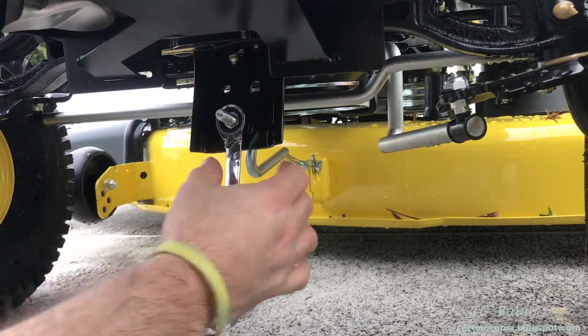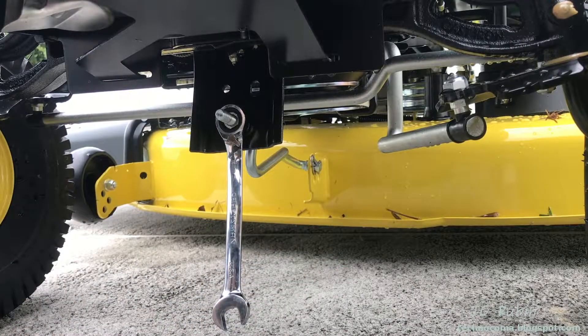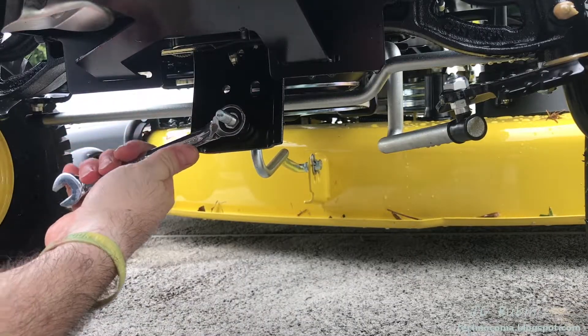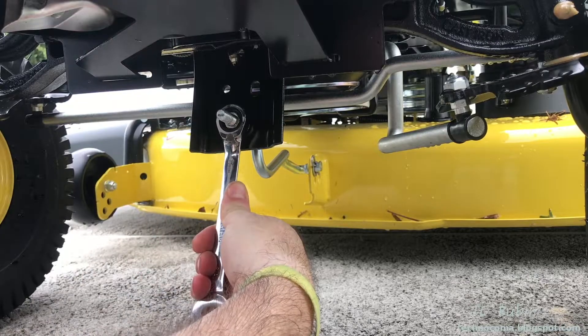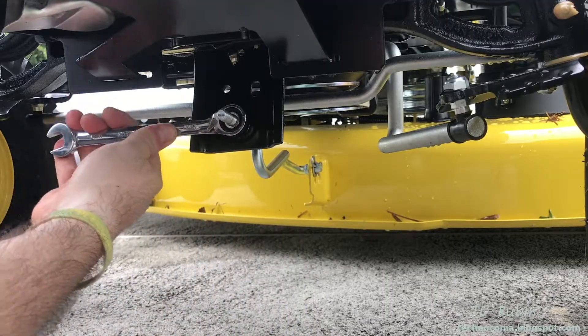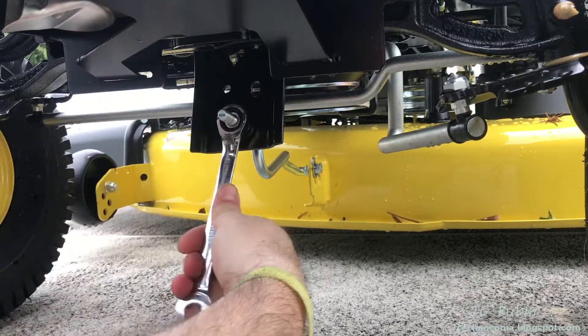The deck is actually designed to have a couple of degrees of forward attack angle. So once it's perfectly leveled, we take the front screw and turn it one and a half turns to lower the front edge downward. I count off the turns: quarter, half, three-quarter, one, then another quarter and half — the leveling portion is all done.